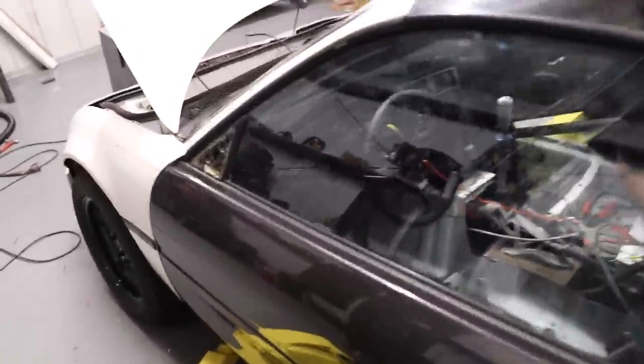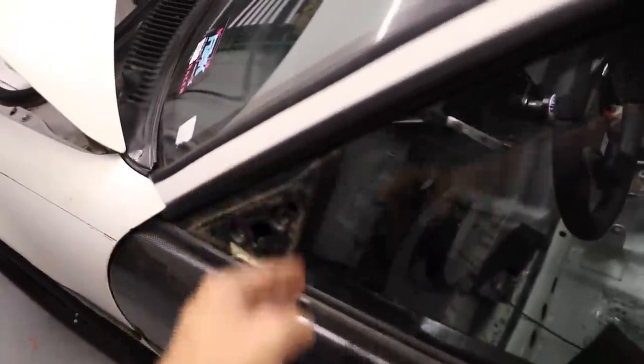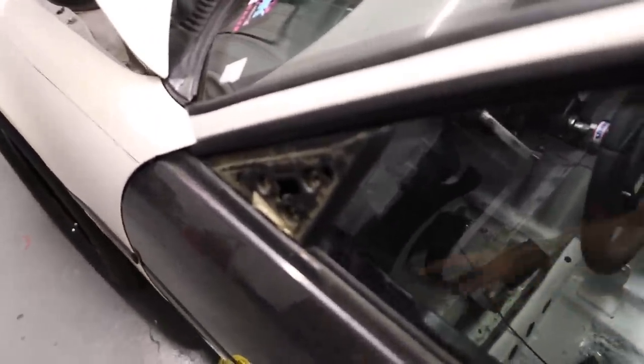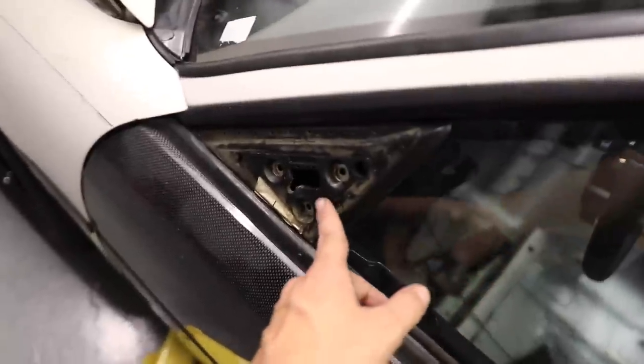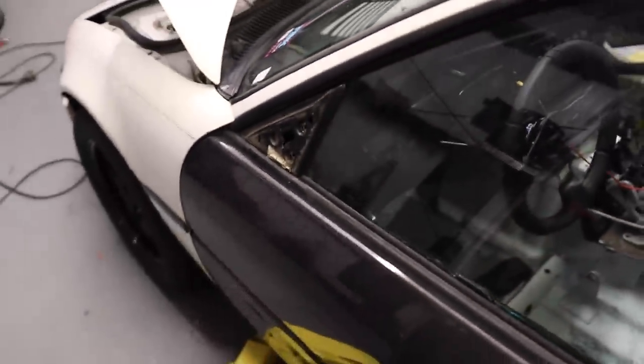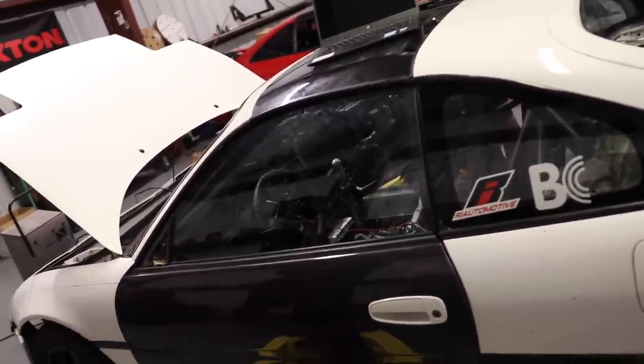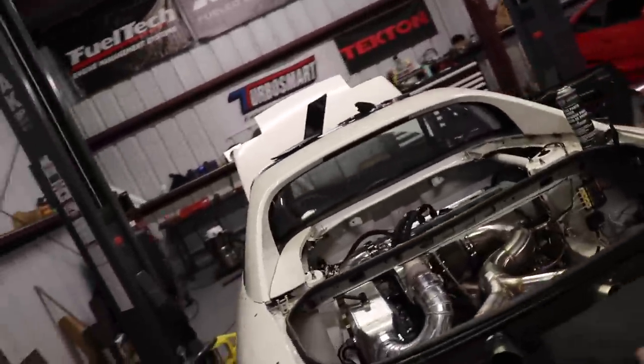From factory, that bracket is supposed to be on top of the stop to keep the window from rolling too far up. But since it's slotted and you can adjust it, we found we can flip that bracket upside down and it acts like a little holder, literally holding our window up in place on the back. There's another one on the front made out of metal — it's kind of jammed in there sitting right up on that stop. There's also another little factory plastic stop right under there that doesn't allow the window to come up either, so we wedged it into place and it works perfect. It shuts good.